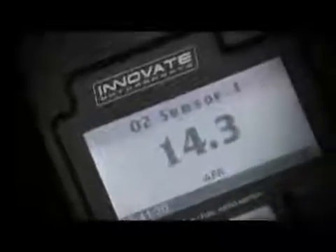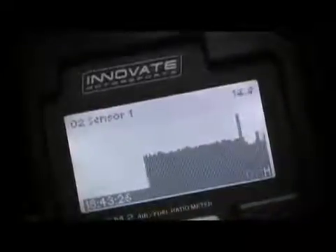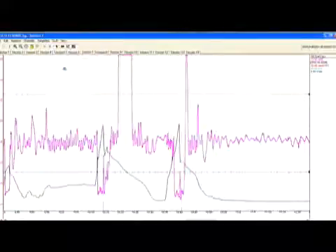The LM2 is unique because it features three capabilities in one: a wideband air fuel ratio meter that features lightning fast reaction times, a full OBD2 scanner that reads and clears trouble codes, and a full feature data logger that can display logged runs on both the device's screen as well as through the Log Works software.